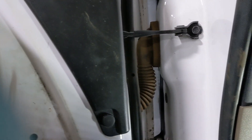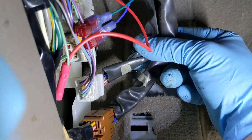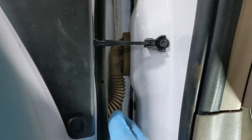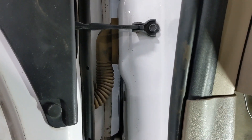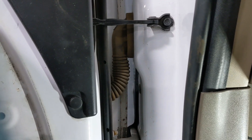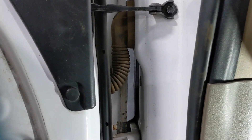As far as fishing it through, it was a little tricky. I ended up unplugging these two connectors because this is your door harness. You can pull this straight out, all the way out, and straighten this thing out so that you can actually try to fish the wire through. It wasn't so bad. I'll show you the passenger side, which is a little bit different.